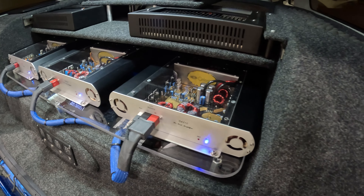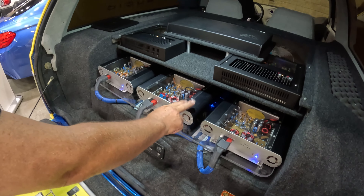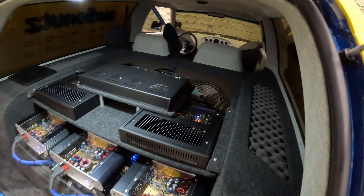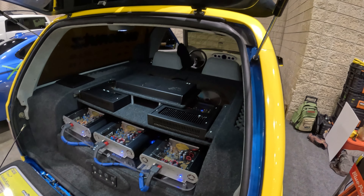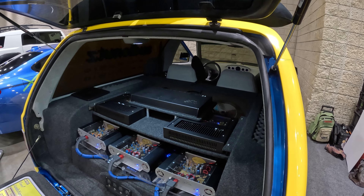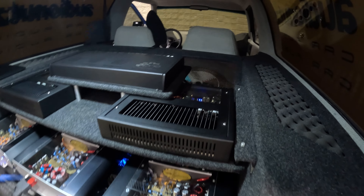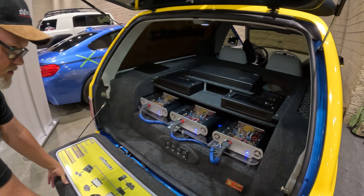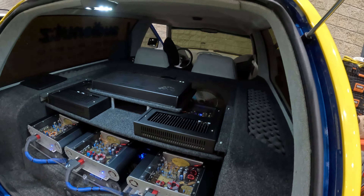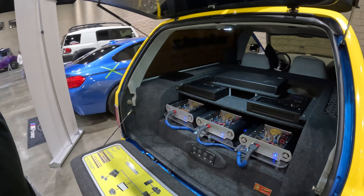On the lower level, we've got a trio of bridged Celestra VA 210s — left mid-bass, right mid-bass, and one common on the subs, in series. And what subs you got back there? Those are IDW 15s. Can't be period correct in a 1990 Blazer if you don't have trunk liner and tweed, right? So the install is trunk liner and tweed, but it also serves another purpose — it's not a hard reflective surface. This is all by design with soft upholstery to help minimize reflections. And you even have foam back here — absorption pillows for standing wave purposes. Absolutely.